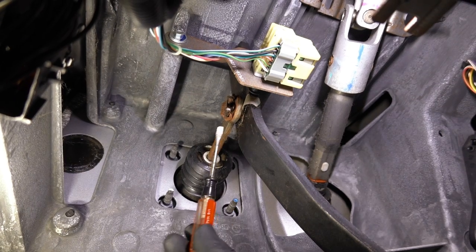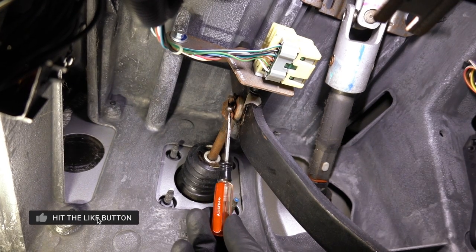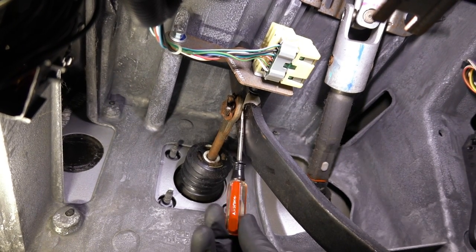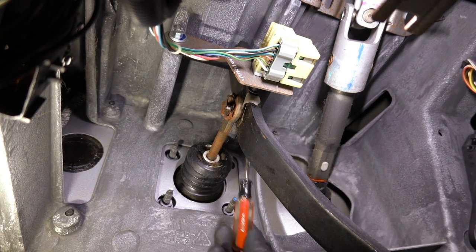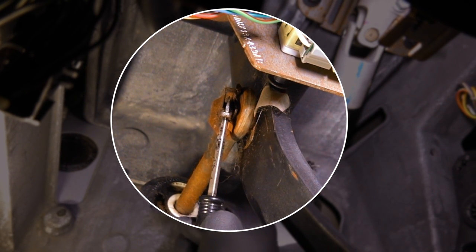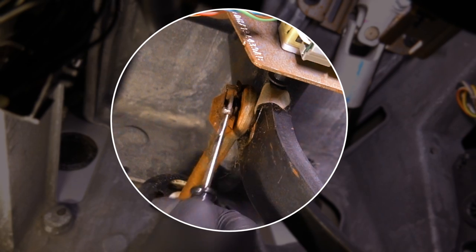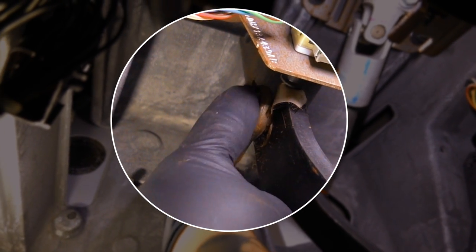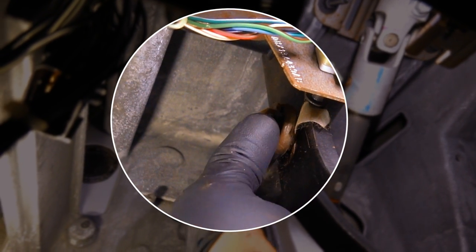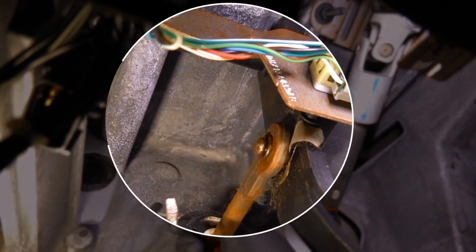What we're going to need to do first is disconnect the brake pedal from the rod using this clip. I've had some bad luck with these clips before where I've broken them. Hopefully I don't do that today. After we get this clip off, we're going to pretty much disconnect the booster from the pedal. It comes off a certain way - you have to unclip it and push it. They're made not to come loose because it is a safety thing, so they're on there pretty good. And it popped right off.